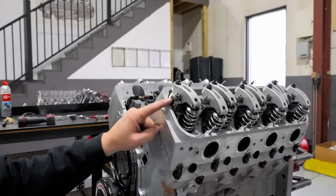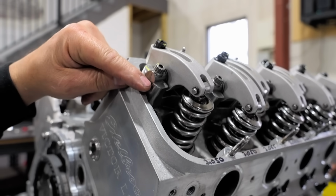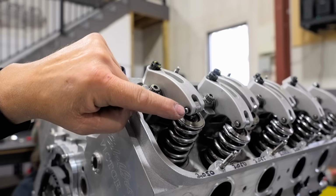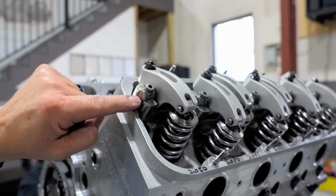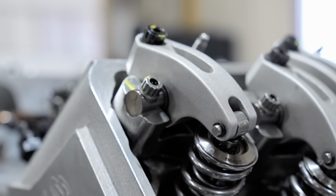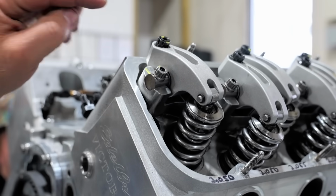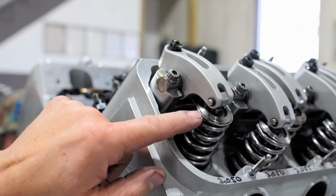So when we raise this fulcrum height on a shaft rocker arm, it literally just raises the fulcrum height. We get the motion on the valve tip right by adjusting the shaft height. Once that shaft height is there, measure the push rod. Don't put push rods in it and move your shaft height to match everything. Move your shaft height to get your valve tip correct.